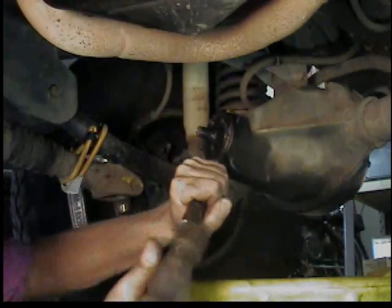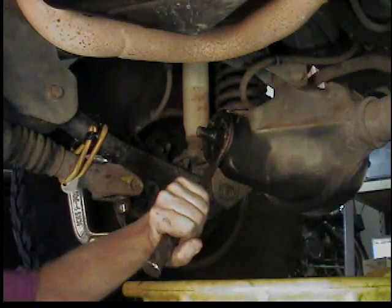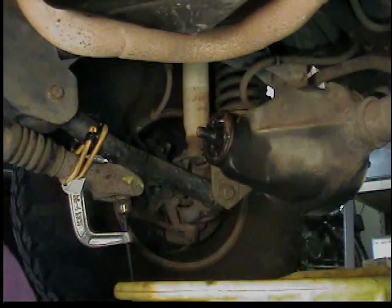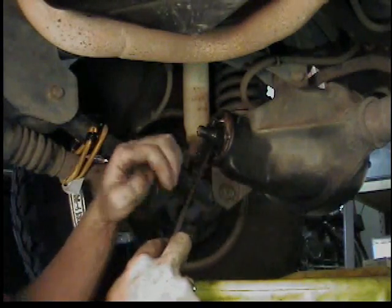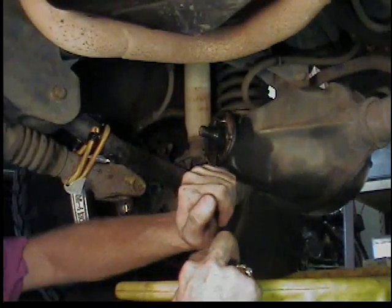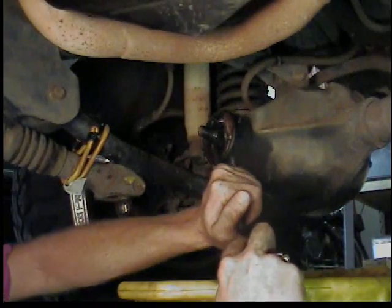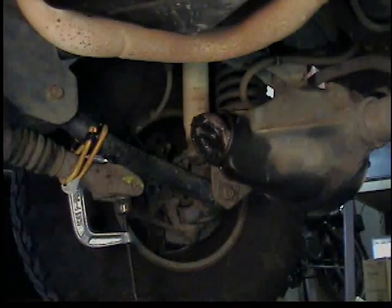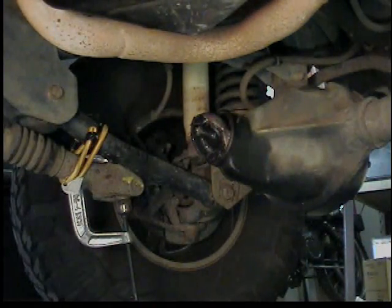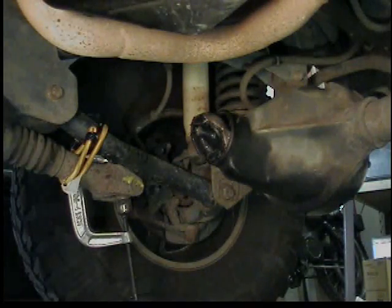It had been glued in last time, and until I broke that glue loose it started to spin. Just beat on it, then went back to the screwdriver method. Be careful when you're prying it out — it's easy to knock the oil pan out of the way, and you're going to need the oil pan underneath at this point, because as soon as you get that seal out it's going to start dripping fluid all over you.